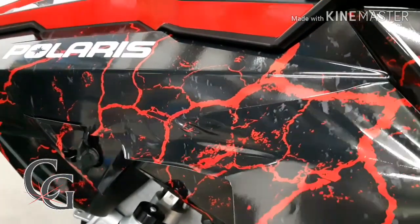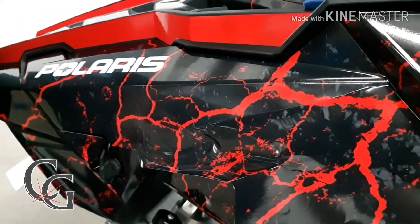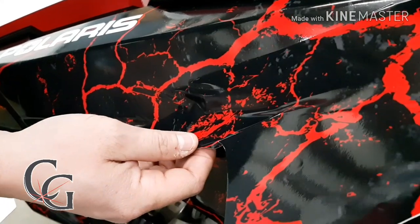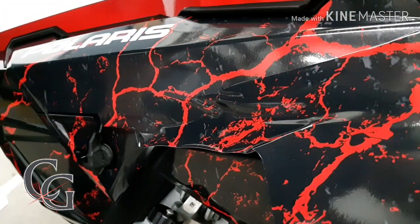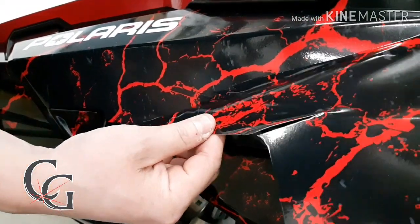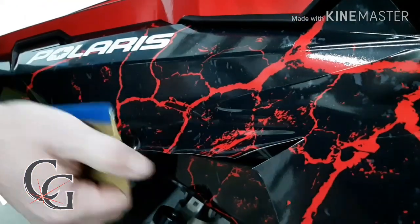Now from hitting it hard with the heat like this, it's going to be soft. So you just got to hold it — hold it off and just blow on it or wait for a second. You can feel it's starting to cool a bit right now. You don't want to pull on it in this state. If you pull on it like this, it's just going to be as soft as can be. Now I can continue to pull on it a little bit here.